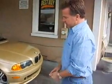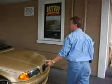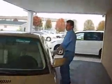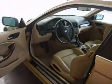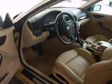Check your tires, see the tread on it, the depth. Look at your interior, your brake pedal. A lot of times a car is saying it's got 30,000 miles, but yet your brake pedal, the rubber and so forth is worn, that's an indicator. You don't see much odometer fraud these days, but it's still a good indicator of things you can look at.